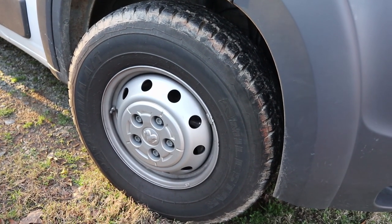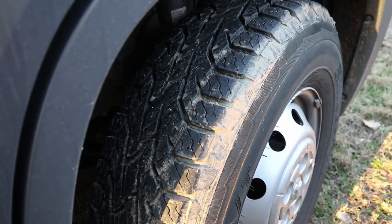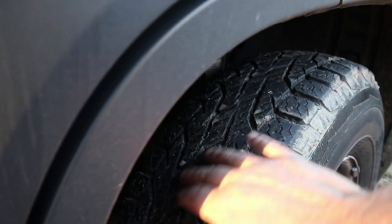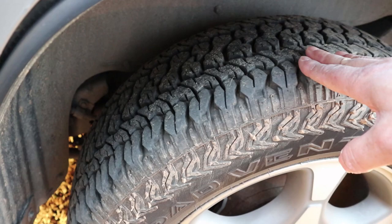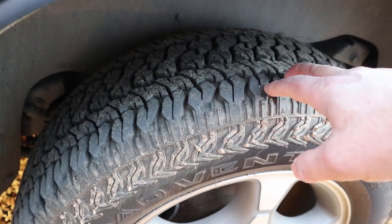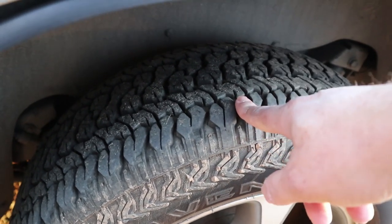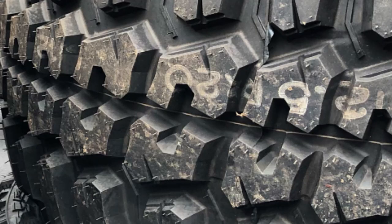These tires are oversized — I didn't do a lift; they fit right on the van. The tires on the ProMaster right now were a good deal when I bought them off Amazon. From the picture it looked like all the individual lugs were separate, but they're not — they're connected for highway use so it doesn't make much noise. The bad news is they don't have really good traction. What I should have bought was the Kumho Road Venture series tires I put on my wife's Trailblazer — great traction in snow, sand, and mud, inexpensive, with individual lugs, and they ride quietly. If you're buying all-terrain tires, make sure the lugs have some separation for better traction.